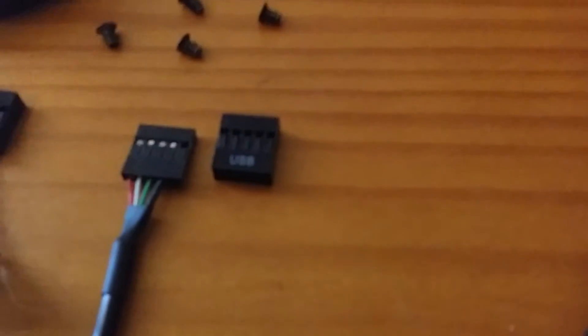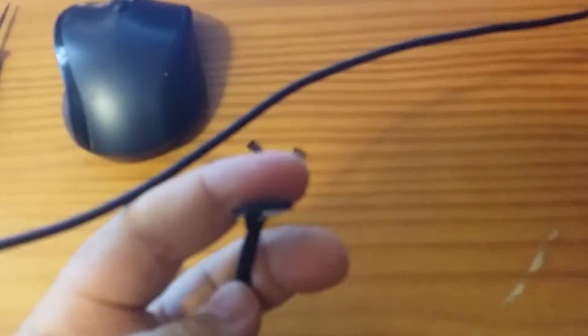Now there are two types of USB connectors, they're all color-coded the same for the standard USB, and that is the flat 4-pin right here. Which would have been okay for me had I had two slimline connectors for that header — but I just had the one, you can see that's a thin line. Then the second one, which is the one that came on the case header and also my USB, was this one here, which is a 10-pin USB. I'm sorry about the quality of this video, but I'm trying to just get some of this out there for people who are building ITX machines.